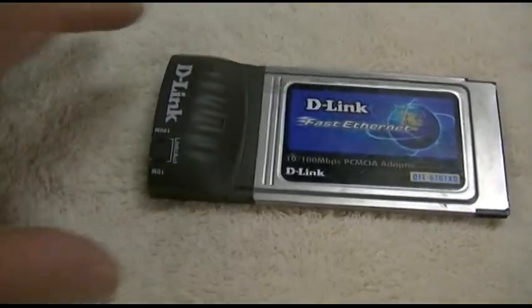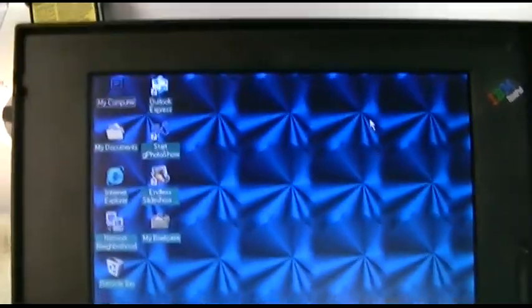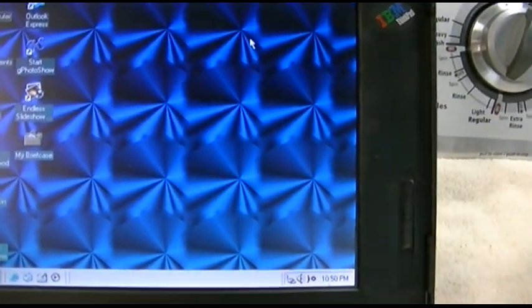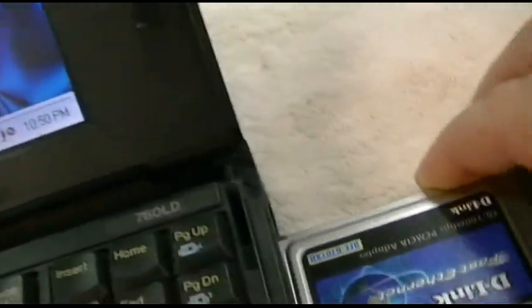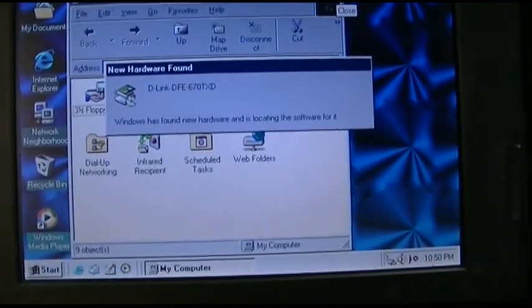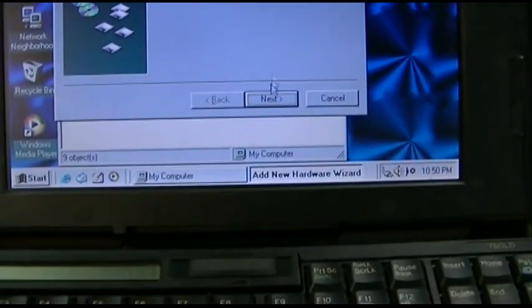So here's the D-Link Ethernet card from KD9BWI. And let's see if we can get that installed on this Windows 98 machine, which will actually aid me in creating the next video. I have the disk already in the drive. You can see it says Untitled Disk. I'll stick this card in. I'm not going to hook it up right now, but that'll be in the next video. Plug it in. It found something. That's good. Oh, it needs drivers. No kidding. Alright, well, we have them right on the disk.